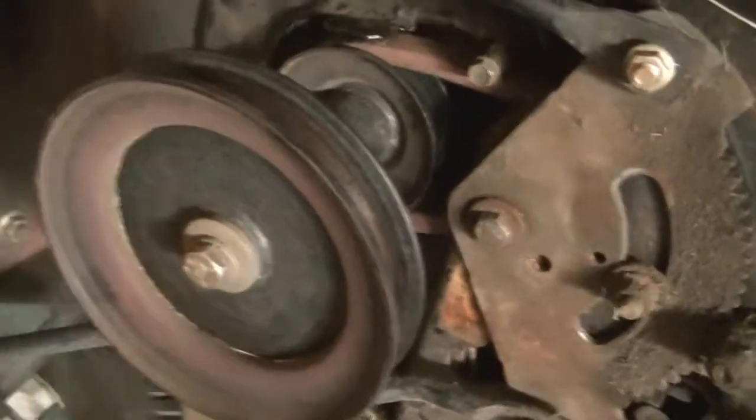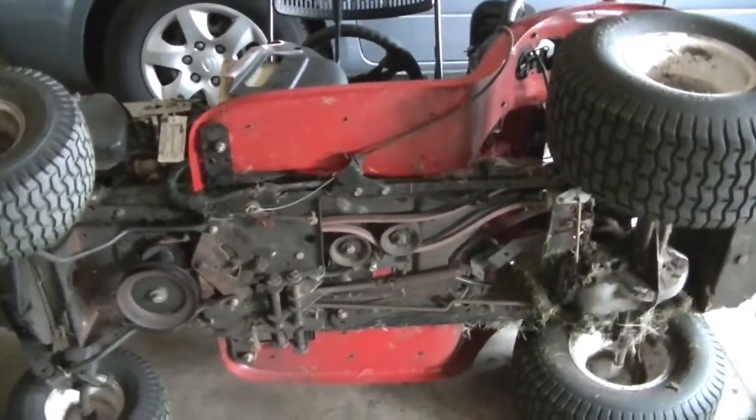This bolt is already tight now, and before turning the mower back, I did slide in the upper belt on this pulley just by pulling this down. It created this space through which to slide in the belt. So the belt comes out from here and goes in. It still needs to go on the other two upper pulleys, which it will once I turn it back.